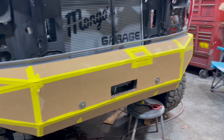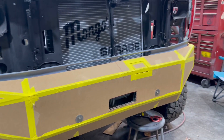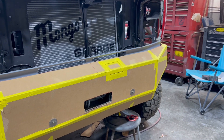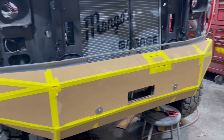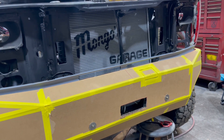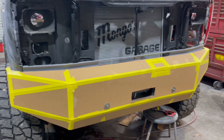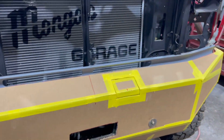They're going to go essentially right in here somewhere. And then across the center there'll be a fair lead in the middle for the winch and two D-rings bolted where those two bolts are. There'll be four bolts across the bottom holding that bumper to the truck, and that is held in by the winch mount.